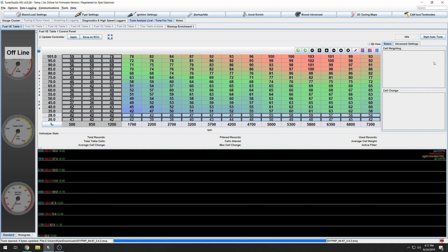What tells you whether you've hit a section is the color — when it turns green, you've got a lot of data points there. It's usually easy to hit the cruising sections since you're in them a lot. Full throttle is up in the higher load areas; mid throttle and low load are in the middle; and the overrun or coasting section is at very low load. I usually leave my second-lowest row unlocked, and my low load tends to run about two to three points lower than the sections that have actually been tuned.